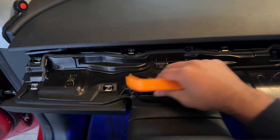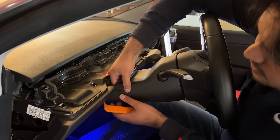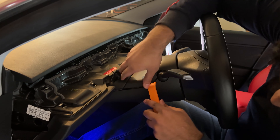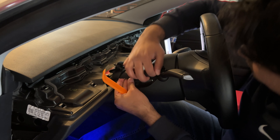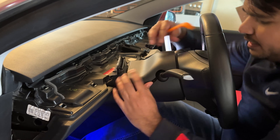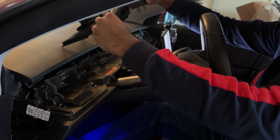The clips are out and you can remove this panel. The easiest way I've found over the years is to reach under here and pry up using your hand — and as you can see, it comes out. Do the same thing on the other side, and then use your pry tool wherever you need to. These V-shaped clips are the ones going on the openings to hold this panel together — you just have to pop them out.